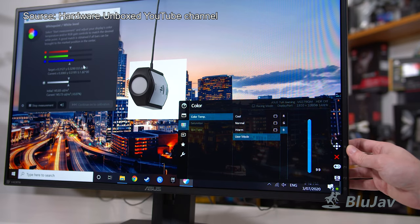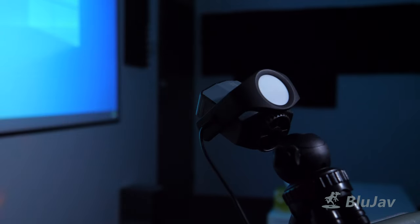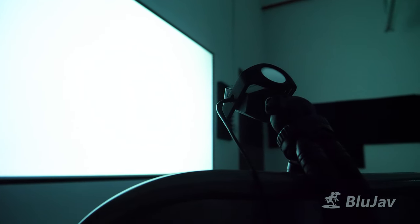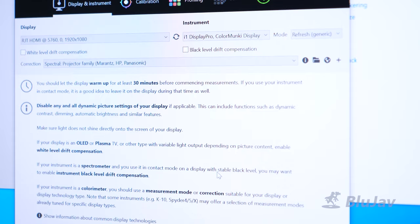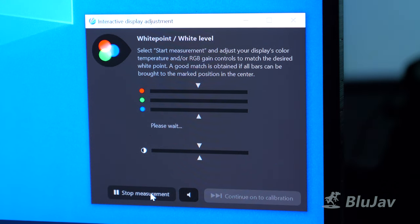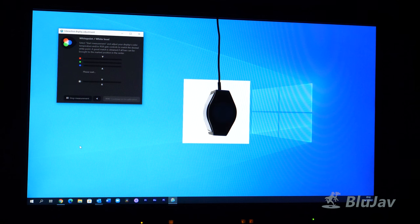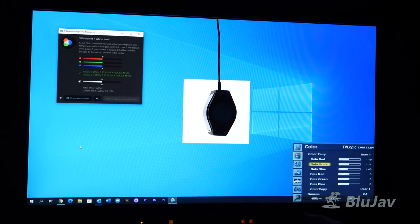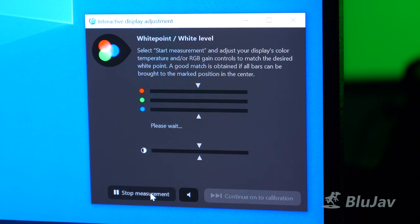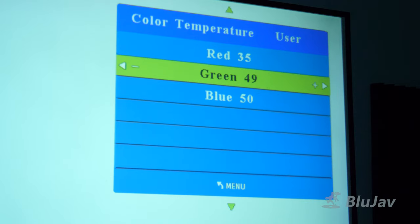The only difference between the Hardware Unbox guide and this is that for projectors, instead of hanging the device over the screen, you will point the colorimeter lens at the projector image at a distance. There are definitely more advanced ways to calibrate screens, but using a colorimeter is relatively easier for beginners and will still give you a very good baseline for color accuracy. You are going to want to do this in as dark a room as possible for the most accurate results. Also, unlike what the guide on the Lumos website says, you should project the image on a wall that is as pure white as possible if you want color accuracy. On the broadcast monitor, you can see that even straight out of the box, the RGB values are very close to being even and usually don't need much tweaking when you recalibrate it every once in a while. However, with the default values on the Lumos Auro projector, you can tell it is very imbalanced, and even after tweaking to balance it as much as possible, the image still does not look anywhere close to the broadcast monitor — I had to tweak it manually by eye thereafter.